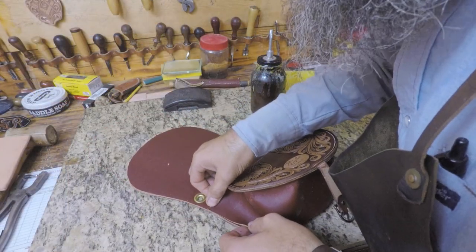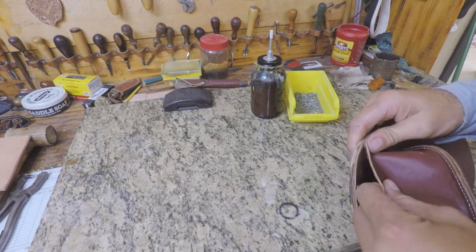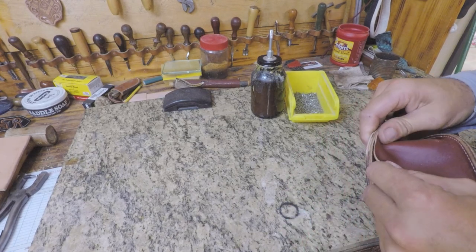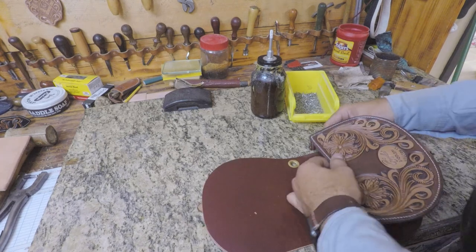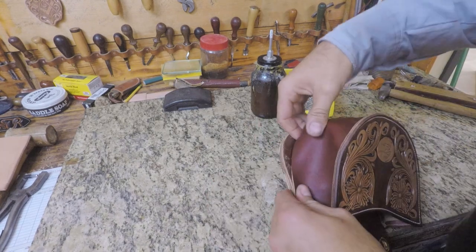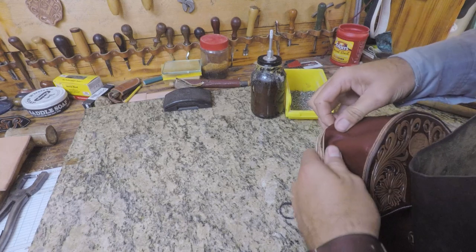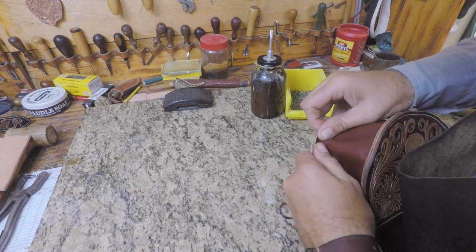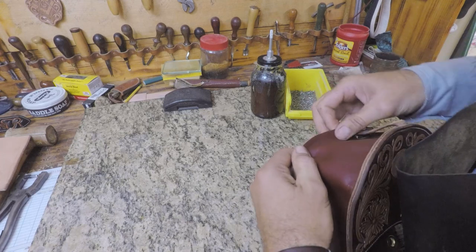All right, so our two coats of glue are dry, so now we'll put it to the top of our gusset there on its mark, and we'll just start doing the same as we did on the front panel, as you're walking it around, trying to keep everything as straight as possible. Try not to stretch your gusset one direction or the other when you're putting these in. Just try to pull them down to the body and get everything, and then you should land at your mark on your other side as well. And so we'll get everything making the corners and laying in there flat.